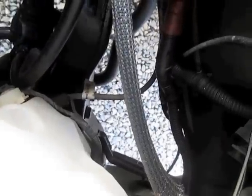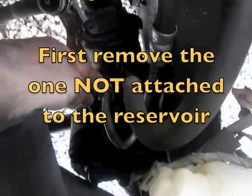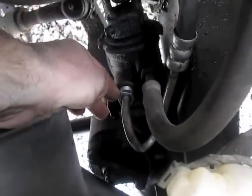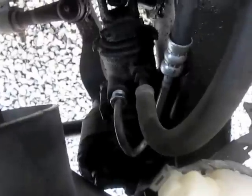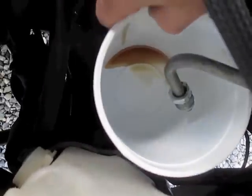I'm going to use my crescent wrench. Pop that. And then I'm going to hand-loosen this. Once I get this loose, I'm going to take it off and put a container under there to catch the power steering fluid. So now I've unhooked it and lifted the hose up.